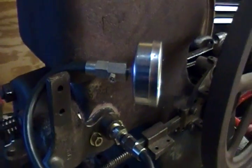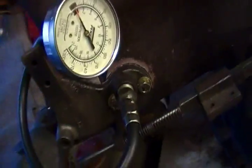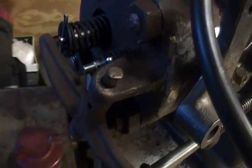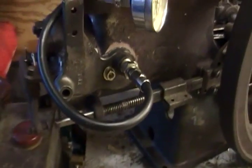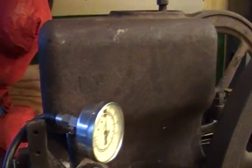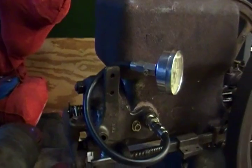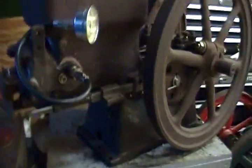I've got the compression tester hooked up — old Penske compression gauge. I just threw the rocker arm on with the old pin to have normal valve action, in case repeated compression cycles one after another would give a false reading. So we have the valves hooked up and we'll do five strokes through compression. I just oiled the cylinder up a little bit more and we'll see what happens.